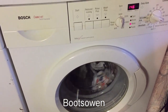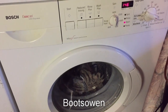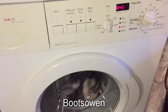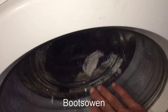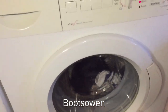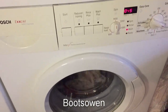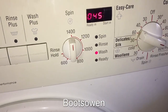So it'll potter away there for a while and I'll check it in a few minutes. I guess it's going to take about 10 minutes to heat up. So I'll check it and report back on whether or not it's getting hot. So it's down at 45 minutes now. In reality, only about half an hour has elapsed, even though an hour has dropped off the timer. And I can't put my hand on that glass at all — it's red hot. So the heating element is working. The laundry is quite hot, getting agitated perfectly. It seems to be still in the main wash cycle. So it hasn't gone to a drain down and rinse yet, and of course it says that on the lights as well.